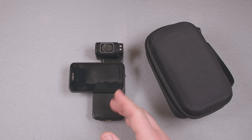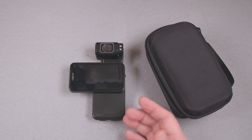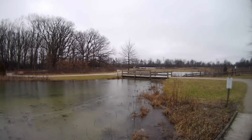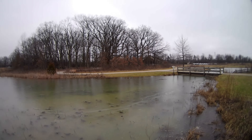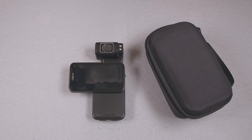There is a pre-record mode that does work — when armed and you hit record, it starts saving and adds the previous 5 seconds to the video. The camera has a wide-angle lens like an action camera: fixed focus and fixed aperture. It has a ton of distortion — seemingly excessive for the actual viewing angle — with significant loss of clarity toward the edges. There's a linear mode that corrects the curvature, but it stretches things, reduces clarity, crops heavily, introduces slight pincushion distortion, and is only available when stabilization is turned off.